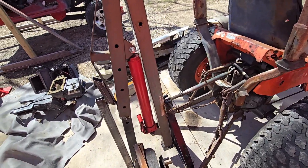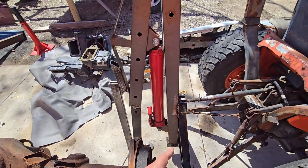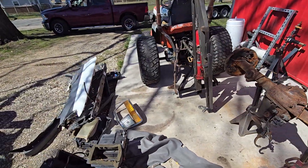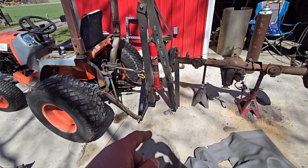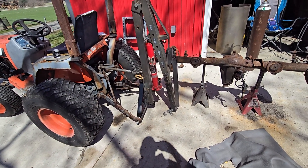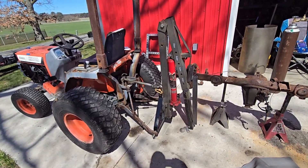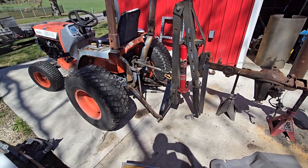For the initial run I kept it really simple — I just welded it straight to it. We'll see how it goes. I did put in this crazy brace. One of the problems I anticipate: when I get 1,500 to 2,000 pounds on it, if it can't hold it up, I'll have to put a wheel in the receiver — like a receiver tube you can buy at Harbor Freight for about 30 bucks. I'll get some hip stock and bolt one of those casters to it to help support it a little bit, kind of like a tag axle on a big truck. But we'll see.